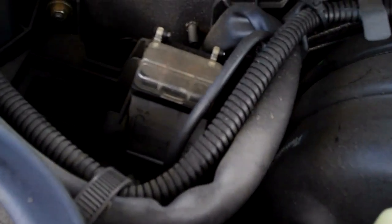The next thing moving on from your brake fluid is your overload protection relay. This overload protection relay is the original relay for the car. These overload protection relays should be updated to the new units because they're basically surge protectors for the electrical system on your car. If your alternator were to go full voltage it would actually blow this relay fuse off and the protection that this relay would offer you would practically be nothing, and it would damage your entire electrical system. So you should update your overload protection relay — it has a double fuse in it and these relays are improved over this old relay.